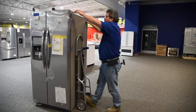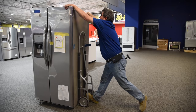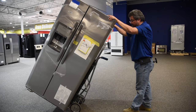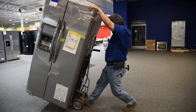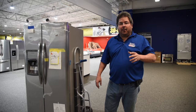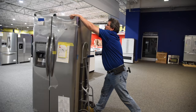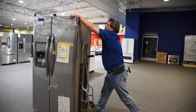So it's just lifting it, finding a good handle — and yes, your wrist strength will increase because you will be using a lot of wrist. A lot of this is leverage: finding the right leverage point to bring the machine over nice and slow, nice and easily. Then I just walk out from underneath it and now I'm ready to take it wherever I want. Put it down the same way — get your foot underneath it and slowly use your weight as a counterpoint as it comes down. Now the only fridges that doesn't work on are the big 36-inch fridges and most of your Whirlpool fridges. You will need a second person to help push it back. Most of your Whirlpool fridges, you're going to want somebody else to help. So let's practice some safe habits — if we do it correctly, there's a good chance we're not going to get hurt. Thank you very much.